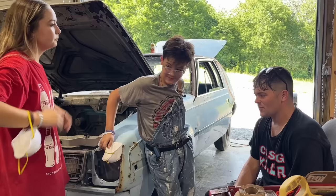Good rule of thumb: if you're repainting something, you've got to sand it with at least 320 to 400 grit so the sand scratches won't show when you paint. If you sand with 180 and then paint with modern paint, you're going to see all those scratches. They're going to sand with that. I don't know if we'll have time to do actual body work like fixing dents — we may have to spray over some of it.